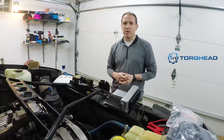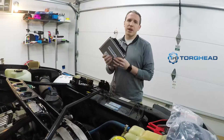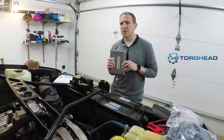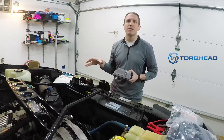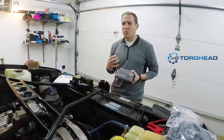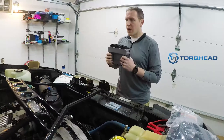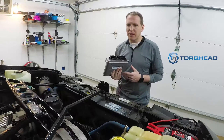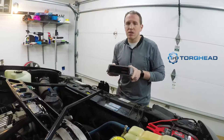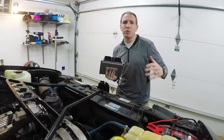There's a lot involved with this - it's also using a new PCM which is sitting right here. This is my favorite part because it allows better tuning, more in-depth tuning, and just more functionality. A lot of people don't want to mess with these LT1s - the old PCMs, it's just not worth their time. But this new PCM has all the same connectors for the Impala, so I can basically take all the wires off the stock PCM and plug them right in here.